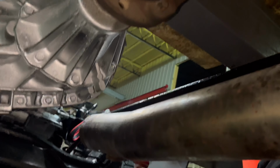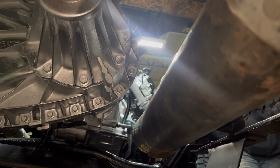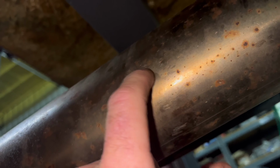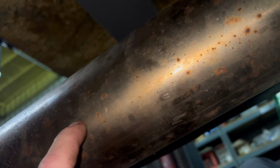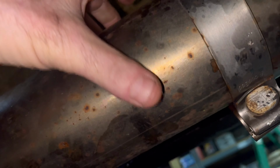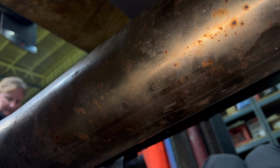So what I'm thinking right now is maybe go ahead and hook up the downpipe onto the turbo and put this thing in whatever massive bind it's going to be in and get the top set. And then I want to come back here with the rosebud, and while it's under mad tension, I want to heat it. I don't know that I could get it completely red hot all the way around. Maybe if I take the table down and heat it up right here as hot as I can, and hope that the tension the pipe is under will bend it and make it form. What do you think? We could put a jack under it too while I'm getting it hot.